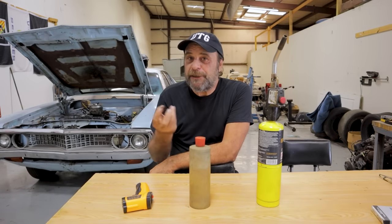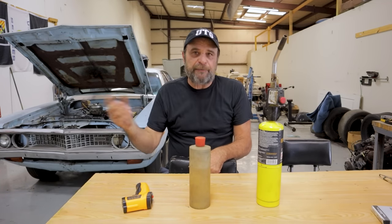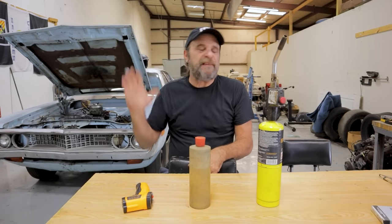It makes sense to me now because we're having problems launching Plan Z. No matter how much accelerator pump I give this thing, I cannot launch it from off idle. I have to actually have the motor loaded up against the converter before the launch. But if I flat punch it, even with all the accelerator pump and all the fuel I'm throwing at it, it just falls on its face.